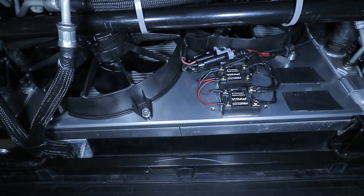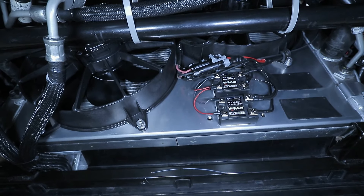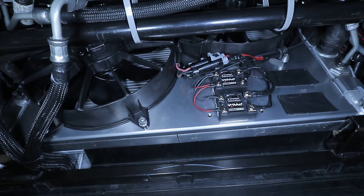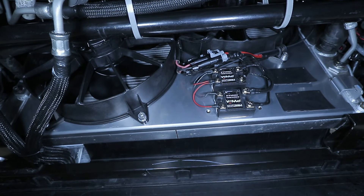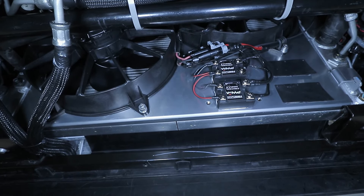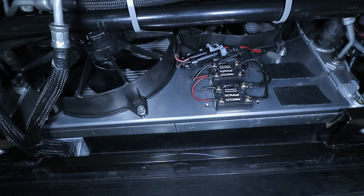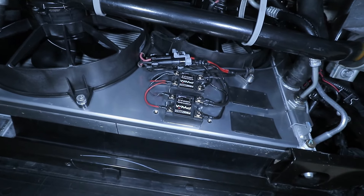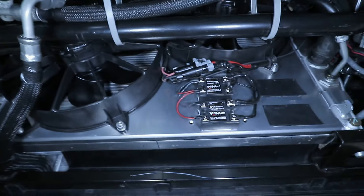I flipped the modules 180 degrees and did the same with the lower fan. The upper fan stayed in its original orientation. That's what I needed to do to make this thing fit. It is a very tight fit — the hoses are in your way. I had bungee cords to hold them aside, and the power steering oil cooler at the bottom was also in the way. I had to pull it to the left to slide in the aluminum chassis by itself. Not enough clearance even with the sway bar unbolted — I had to take everything completely apart.